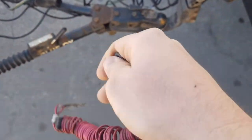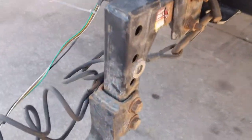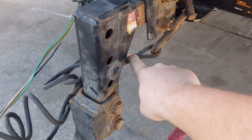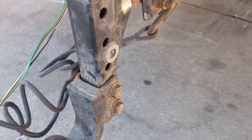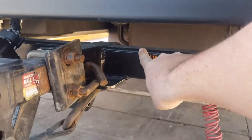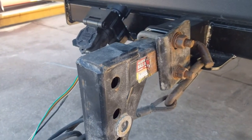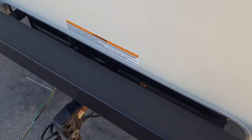Grab your cable — this is your last-ditch effort to save your car. If your hitch breaks, your tow chains will catch it, but sometimes those snap because nobody really maintains them and you don't know what's underneath. If this bracket broke — I've actually had this break on a Super Duty — it's just three bolts holding it in. If everything breaks and falls off, you've lost your car. So secure this cable to something that isn't attached to all that hardware — on my camper it's the bumper.